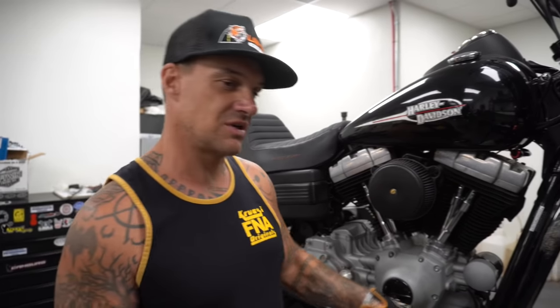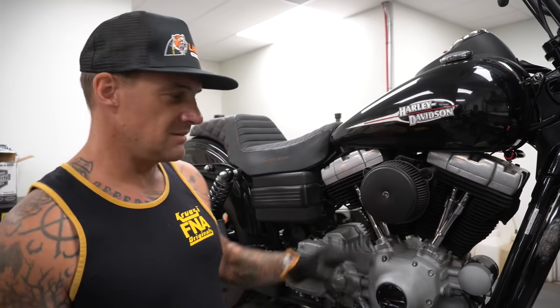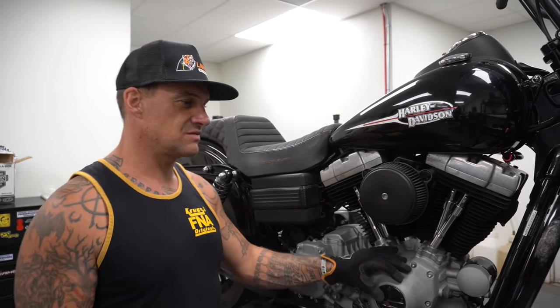The oil pump's getting a little weak. It's taking a while to build oil pressure, which is a good sign the oil pump's going out — that's real common in these. How many miles are on this thing, Jake? 42,000. We're going to check the crank run out and all that while it's out, see how that's looking. The bike has not been abused, really. It's just a good road-tripper.